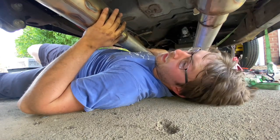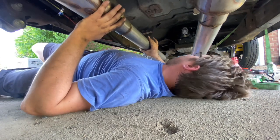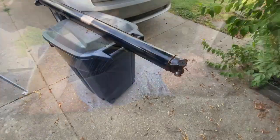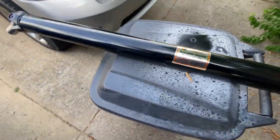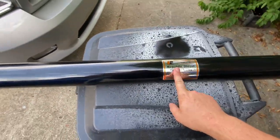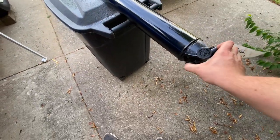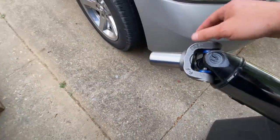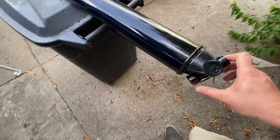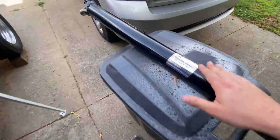It's time Hayfield Garage gets a lift, because oh man, yeah we need a lift. Let's go pick up a driveshaft. A couple days later and several hundred dollars later, we have this brand new driveshaft from Republic Diesel in Louisville. Very very nice piece - fresh heavy duty u-joints on both ends. I think this is a 1350 on this end and this one is a 1330, which is the pinion side.